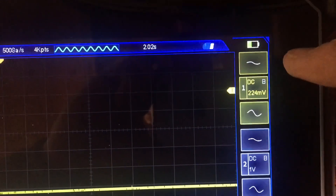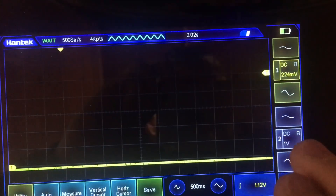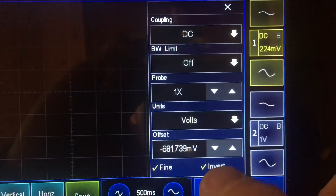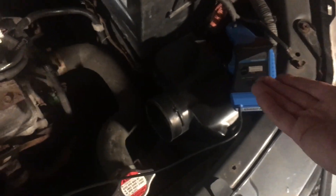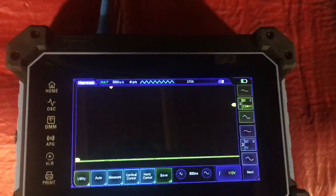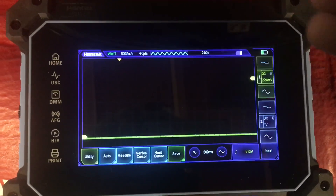I don't have a synchronization pulse to index to any cylinder, so it's relative compression proper — we won't know which cylinder is which, but that's neither here nor there. I've only got channel one selected. You'll note I'm on invert — that's just a function of which direction you have the clamp on the probe. I set this up for single one-shot mode: I'll get my wife to crank the car while we watch the screen. Don't be surprised when the trace doesn't paint right away — there's going to be a significant delay before you see it, but in single mode it will hold on screen.